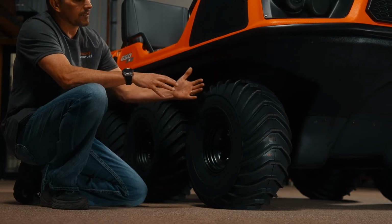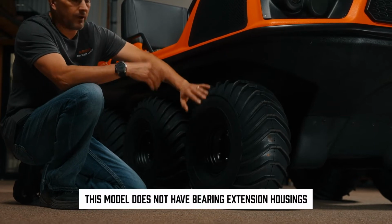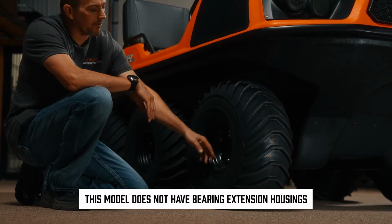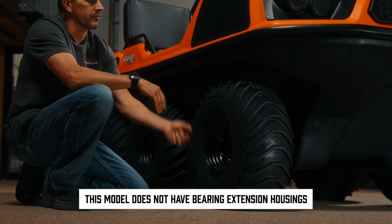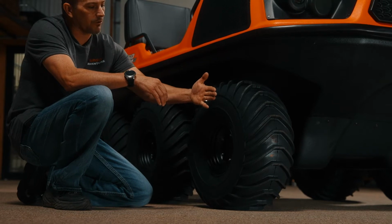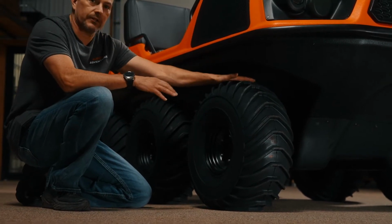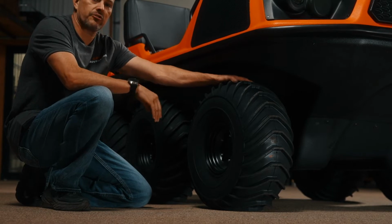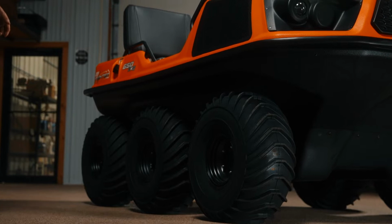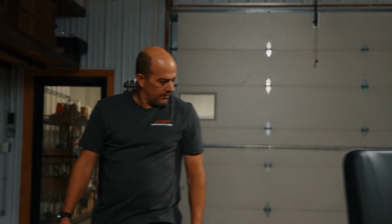The steel offset rim is standard on all of the new Frontiers. For those of you that are running tracks, and you can call and ask questions on this, we can flip the wheel from side to side on the vehicle. There are actually 2 valve stems, so you can still check your tire pressure, but it moves your wheels and tires out a couple inches, and it allows the adequate clearance required to run the 18-inch tracks. Short of that, we will work our way around the side here to the back of the vehicle.